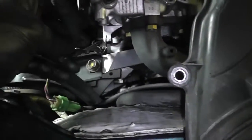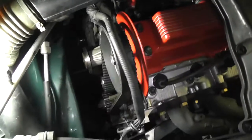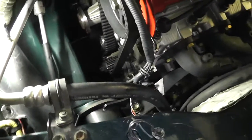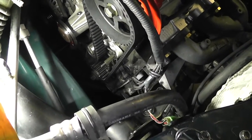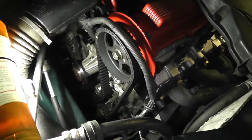The belt being exposed down there is fine. I'll use these little clip deals to install it so it runs on this side. You really should be able to change the timing belt in like 15 minutes with it all exposed like this, and you can inspect it for damage a lot easier. Plus the engine's going to look cooler, especially when it's running. There are a number of ways to cut this, but I'm going to go with the death wheel.